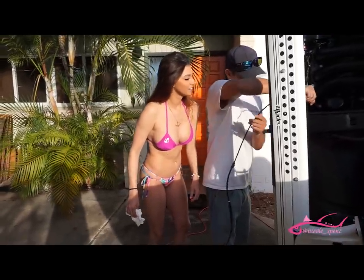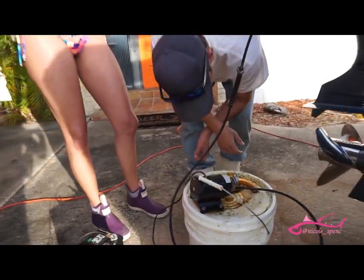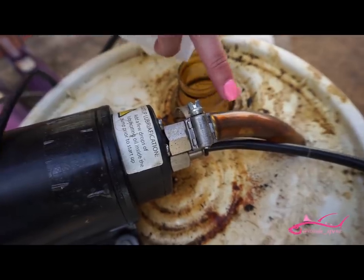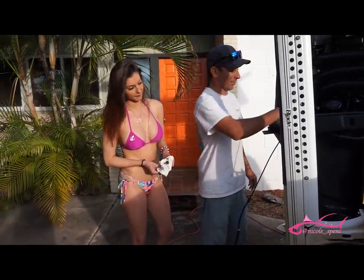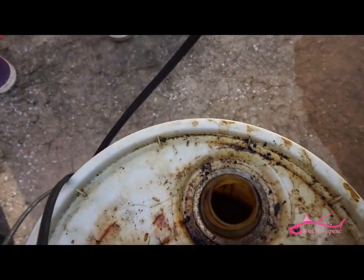It hasn't started at full yet. It's wanting to — it's going to clear the oil. It's kind of being slow right now. You've got to prime up. You can sort of see where it's pumping the oil through, it's starting slowly. Basically, you let this run until you don't see any oil coming out of there, without frying your impeller. Yeah, we don't want to do that.